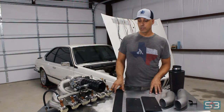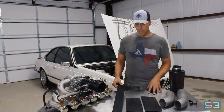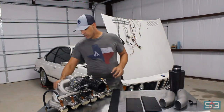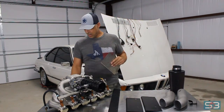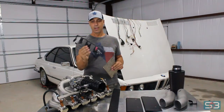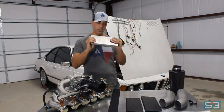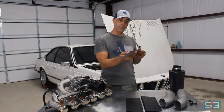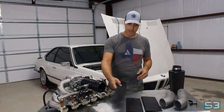Now for the coil packs — in the first video I mentioned I was going to do coil on plug. Technically LS coil packs are not coil on plug, they're near plug essentially. What I ended up doing was actually making a coil pack holder for my cam cover. I went to the scrap yard before this pandemic and picked up some old scrap stainless — about five foot long initially. I was trying to emulate the bend from the original coil pack holder from the salvage yard, which gives it a little structural rigidity. Using the same profile, I put a little wrinkled paint left over from when I painted the cam cover, and this now holds my coil packs.